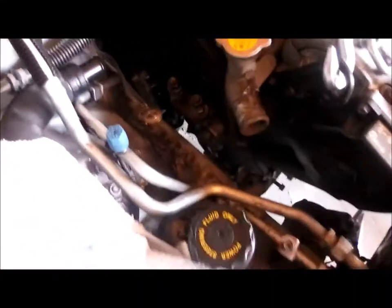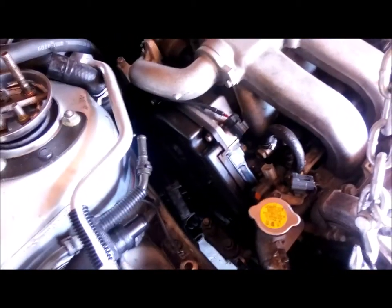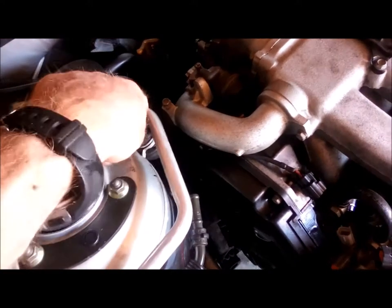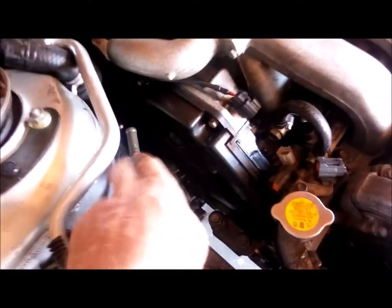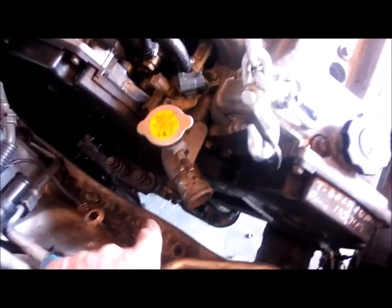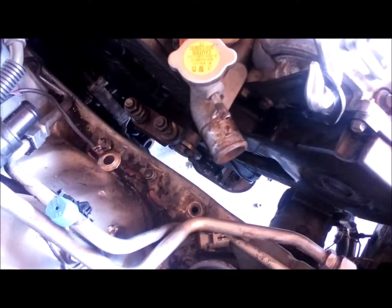It may not look like it now that it's down. I don't have a good light, but you might look in there and say, wow, all kinds of clearance. But when you're putting this thing in, that water pump shaft is sliding all the way down. Another point, you see this air conditioning line? This part of the manifold right here rubs right on that. It doesn't really hurt it, but it's so tight going in there. It's just amazing. This thing here is going to rub on the timing cover, because the whole engine has to be forward to clear the flex plate. So to clear the flex plate, you're clear out here on that water pump shaft. So yeah, it looks like a lot of room once you got it in. I had the crankshaft pulley on there, but I took that back off because I knew that stuck out too far. So pretty much there's no pulleys on here, everything's off. All right.